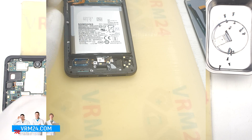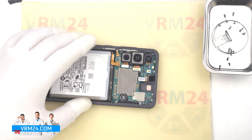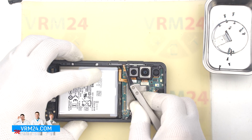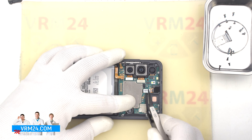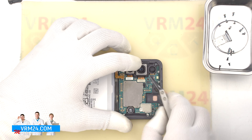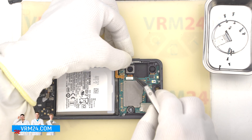The body of the microphone is located on the other side, which means that if we insert something into the microphone hole, we are unlikely to damage anything but maybe the membrane. Then we disconnect the connector on the side buttons. And we disconnect the connector and remove the front camera. Then we detach the two rear cameras. It's better to hold the cameras so that they don't fly out. Try not to touch the lenses so as not to damage them.